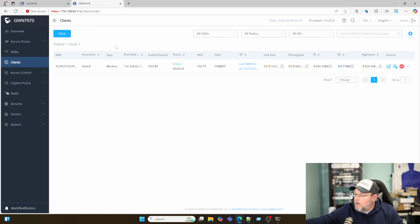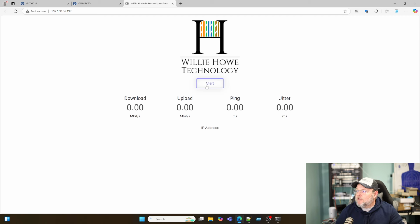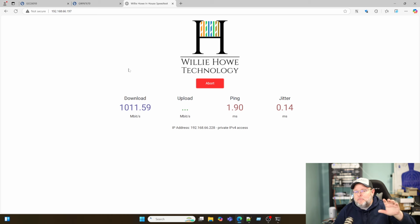So my gig connection, I'm not getting gig tonight. So lots of traffic probably in the neighborhood, lots of traffic on the internal network. And so on my desktop, I got less than 400 megabits down. So I'm going to have to fire up the old internal speed test server and see what we get to that. So let me do that real quick. Hold on. Okay, so this is my internal speed test server, which is 66.197. From my desktop, it's 1 gig to a 2.5 gig switch, which is uplinked to the speed test server at 10 gigabit. So I'm going to go ahead and pull this up on my phone on this Wi-Fi 7 access point.